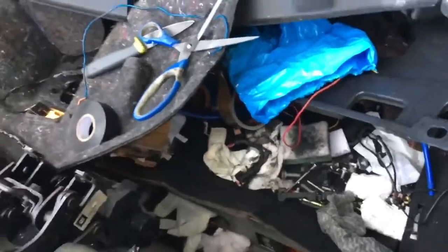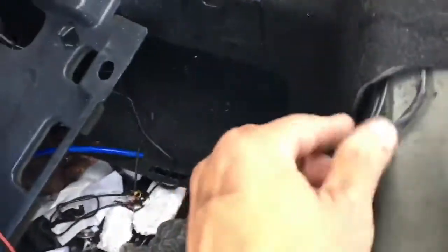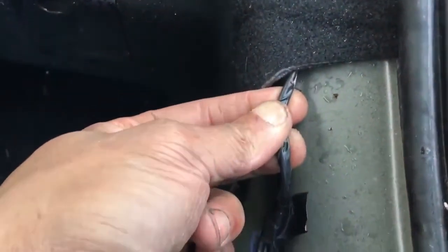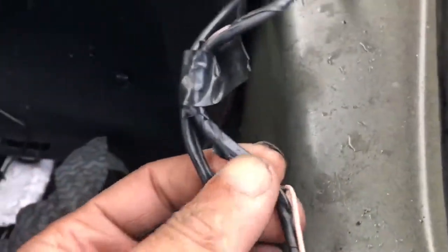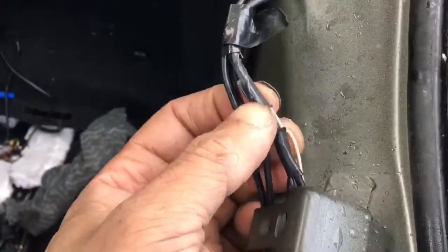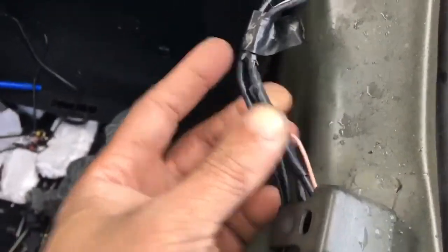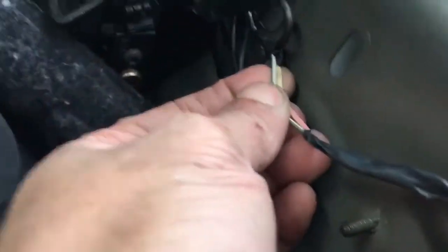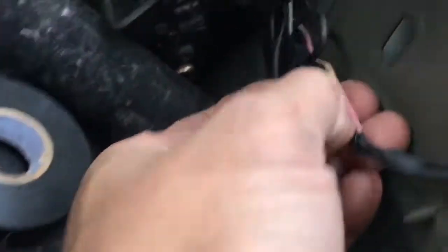Because of the ignition and everything I have a few cables here. Those two are my parking sensors and this is my extension for the rear camera. The black one is the minus, the pink one is the plus. I extended it — it goes through here, goes to there, and here I split it into those two. The black goes to minus and this is still the plus, which goes to there, and then I extend it here again.